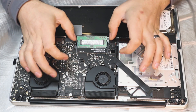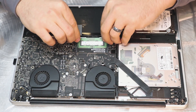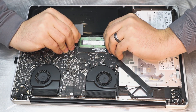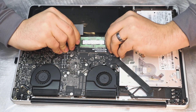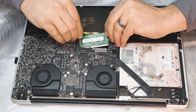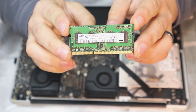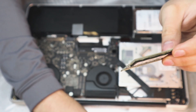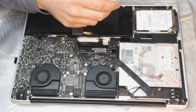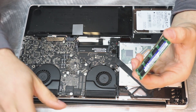Here's the exact way you do it — it is not complicated. You pull these two tabs out: the first one pops up, rip that out. The second one may be a tiny bit more wedged in there because it sits at an angle, so just wiggle back and forth until it pops off. As you can see, the old ones were two gigabytes each, so we had four gigabytes of RAM total. We're going to ditch these and replace them with two new eight gigabyte sticks, giving us a total of 16 gigabytes of RAM.